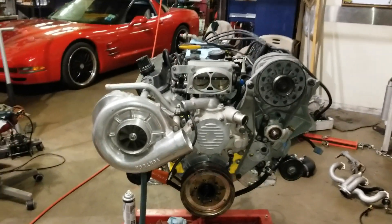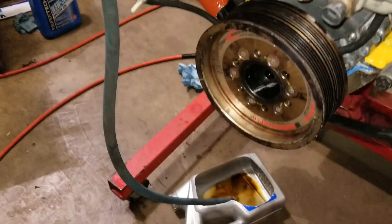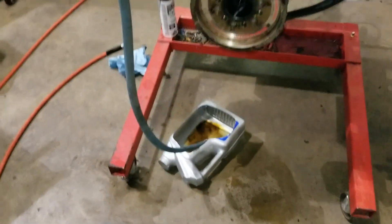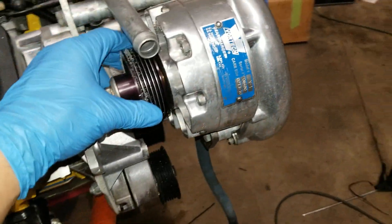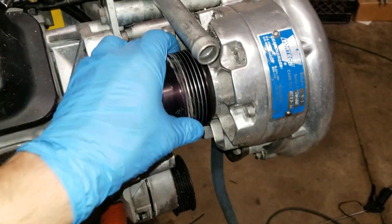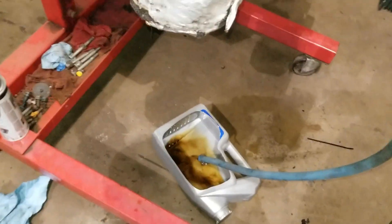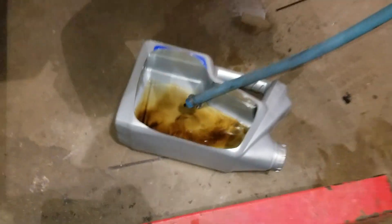Alright, there she is. I ended up flushing out the supercharger using a funnel and a rubber coupler, then used my vacuum pump on the bottom to flow some fresh oil through it and examine it. On this end I used my pinstripe remover wheel to actually drive the supercharger to keep the gears inside rotating as the oil drips past them to clean them up. The dark oil came out first, and it ended up flowing out much cleaner oil at the end. I didn't see any metal fragments in the oil — just dirty old oil.